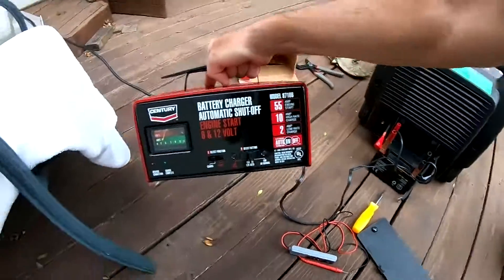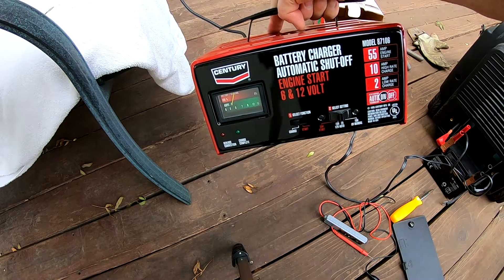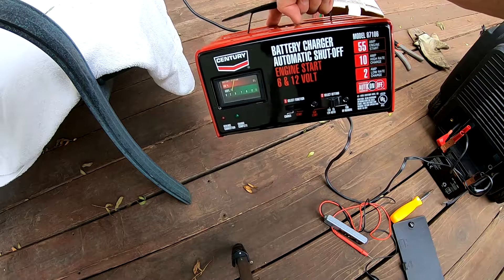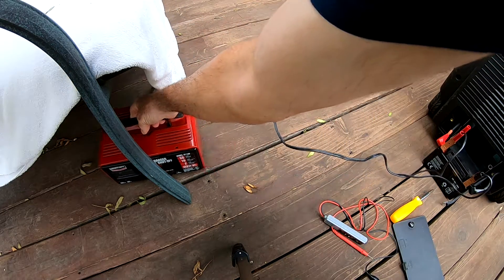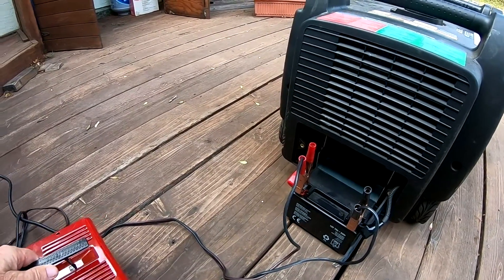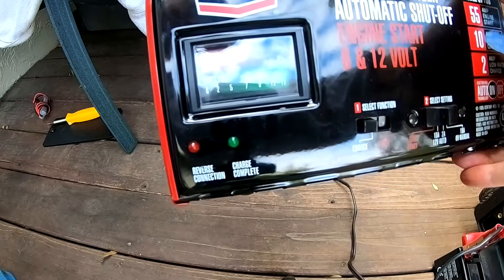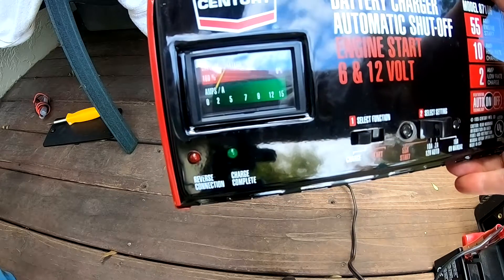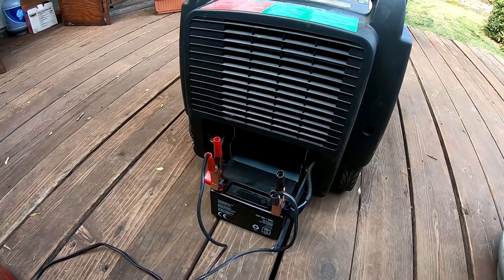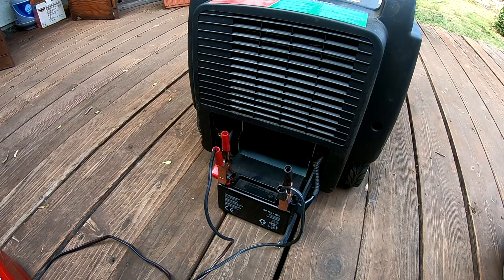So here, you can see it's down now — it's not at 100% anymore. It did use some energy trying to start the engine. We'll just let it run for a few hours and see if it gets to 100%, then try starting it again. It's been charging for about six hours — that should be enough. It's only a 7-amp-hour battery and we're charging it at 2 amps. It's not quite at 100%; it's still going in at about a little bit less than 2 amps. It could be that this battery is kaput — it is about 22 months old, which is not a super long time for this kind of battery, but we'll just see what happens.